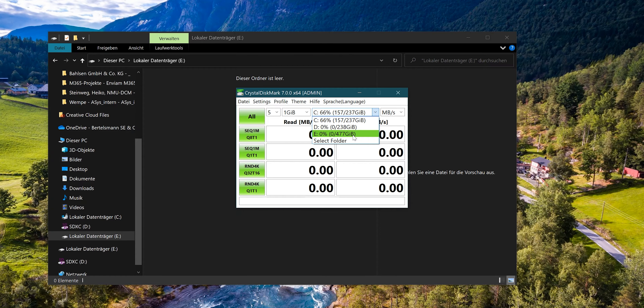I'm using a Toshiba 512 GB here, which is the stock NVMe drive from my Dell XPS — not the fastest. That's why I upgraded it to a Samsung 970 EVO Plus internally. We'll run a quick CrystalDiskMark test for sequential reads and writes. Keep in mind that 4K IOPS performance depends heavily on the SSD itself, not the USB 3.2 Gen 2 connection. Also, if you only have USB 3.2 Gen 1 at 5 gigabits, it's not worth it — just stick with SATA SSDs.